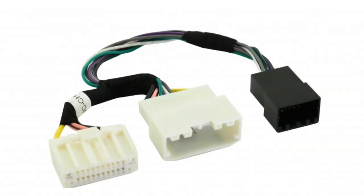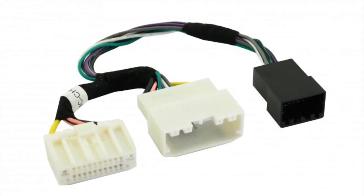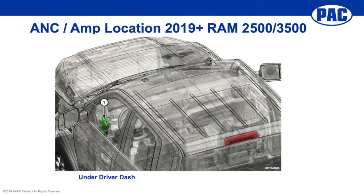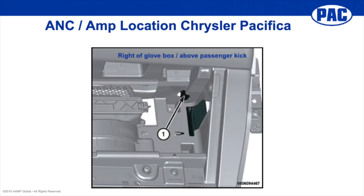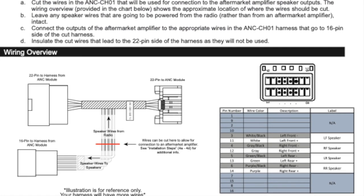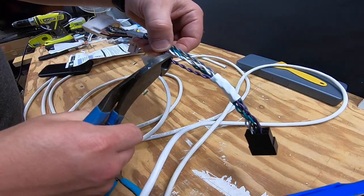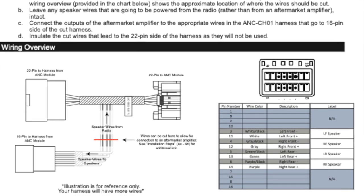You also don't need to de-pin the connector. You can actually pick up an adapter harness from Pack Audio, which I'll link in the description below — this covers a wide range of vehicles. The Pack Audio module comes with instructions for Ram 1500, 2500, 3500, Jeep Grand Cherokee, and Chrysler Pacifica with different amplifier configurations. The super cool thing about the Pack Audio harness is that if you plan on going with an amplified system in the future, all you need to do is pop that harness out, cut it in the middle — it's clearly labeled which outputs go to your amplifier and which ones come back from your amplifier and go to your speakers — so you can easily add a system without touching or cutting any of your factory wiring.